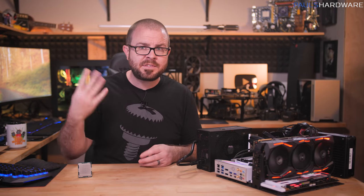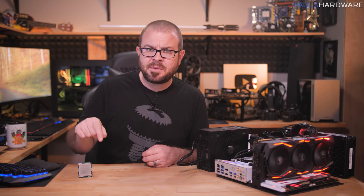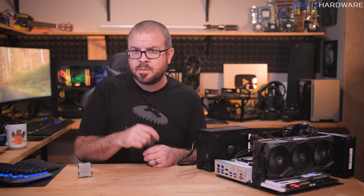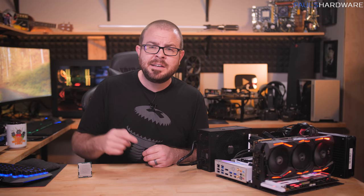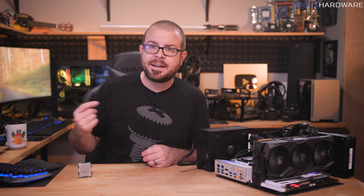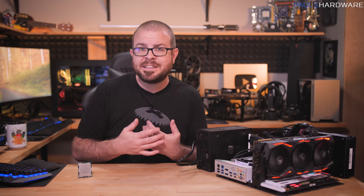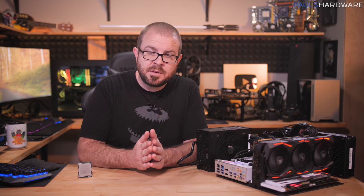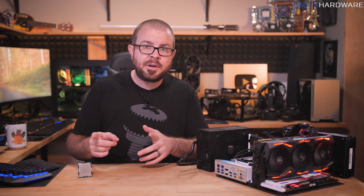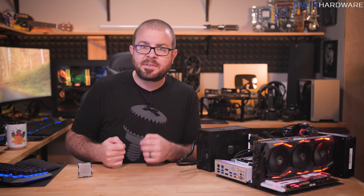There are four of them this time around, technically five, but Socket AM4 and X570 on AMD Mainstream, Socket LGA1151 with Z390 for Intel Mainstream, Socket LGA2066 with X299 for Intel high-end Core X CPUs, and then the new Socket sTRX4 motherboards with the AMD TRX40 chipset are for AMD's Threadripper 3 series CPUs, and those are all brand new. Now, all of my rigs are open test beds like this one, and I've made my best efforts to make them run the exact same memory, CPU, cooler, and graphics card where possible.